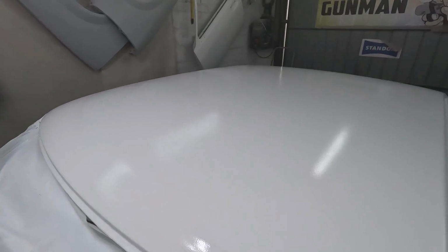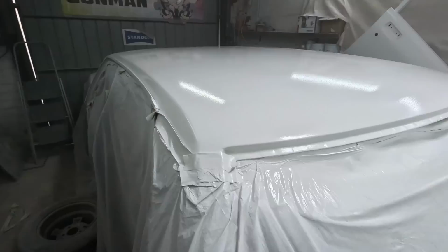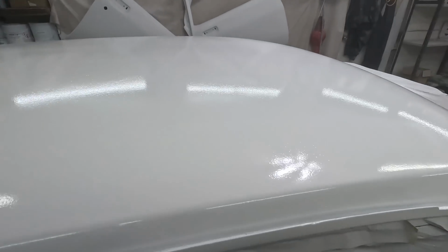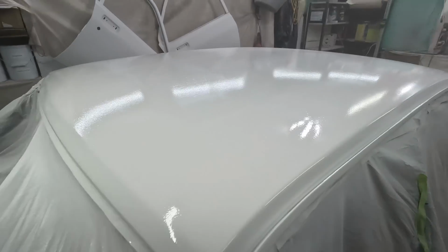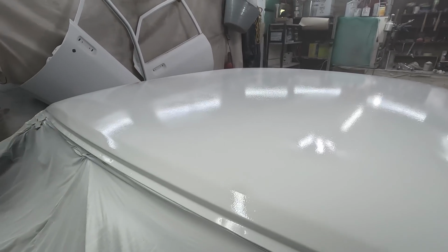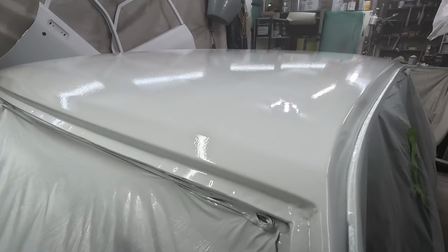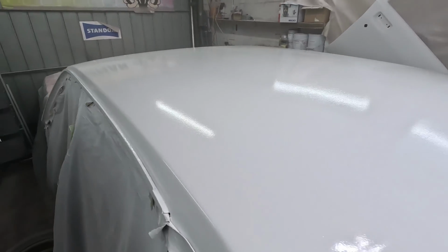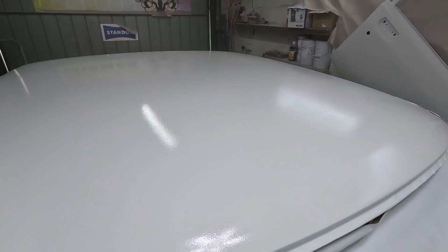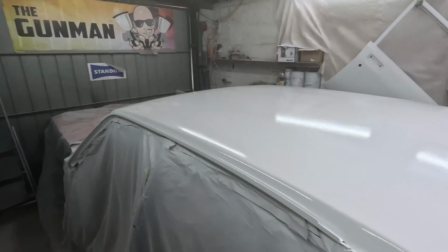short of a polyester spray filler. You will struggle with that unless you find a way to thin it down with acetone, which kind of defeats the purpose of it. I've actually got a review on some polyester spray fillers coming up soon. That'll probably be one of the next videos on the channel. I got an opportunity to use a couple of different polyester spray fillers on this. Some of them had mixed results, so to speak, but either way, I'll get into that in that video.